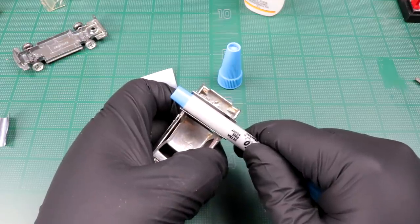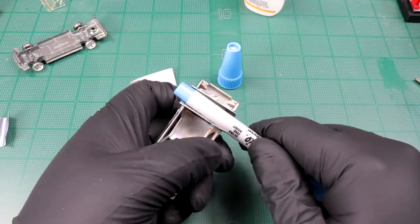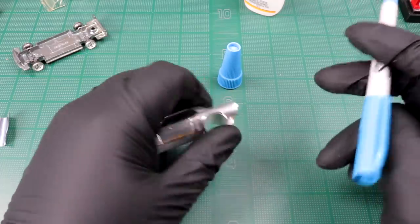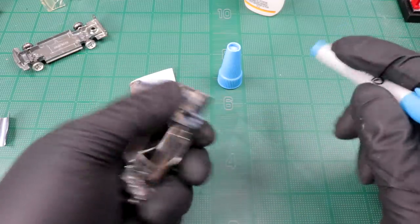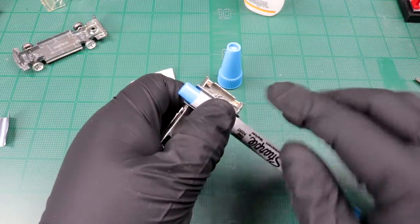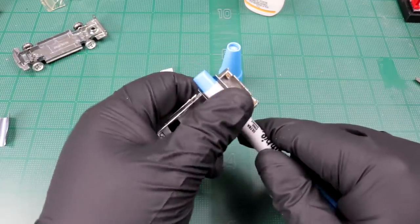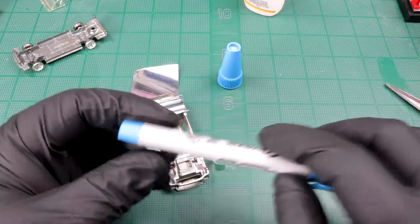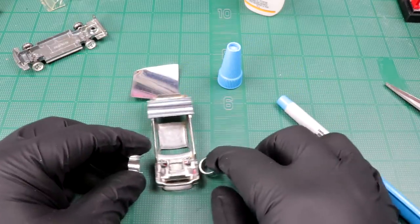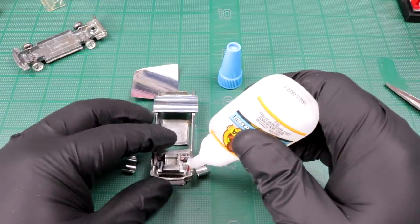And what we're doing is we're making a nice wheel well arch, because we're going to come in and add putty on top of here because we have to do a wide body. And this little piece of zinc is going to hold our nice wheel well shape, just to save us from a bunch of extra body work that we don't need to be doing at the moment. You can do this with a pop can, just as easy.